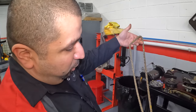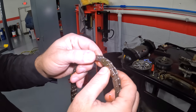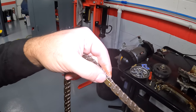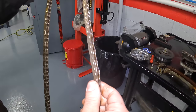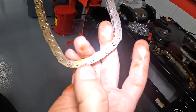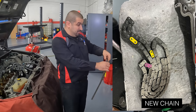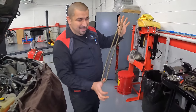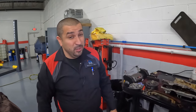And that's exactly what we have in this RAV4, and I'll show you why it overheated. If you notice, there's no paint marks here. But if you really look close, right on this link, that's actually what used to be painted — that's how they look from far away, can't really tell. But when you come close you can still see the painted ones. Here is one right here, and here is the other one, and if you go around you're going to see the last one. Usually these are super bright and you can see them from a mile away, but I can barely see anything. This chain overheated — when they overheat past their normal operating temperature, that's when Toyota wants you to replace them.